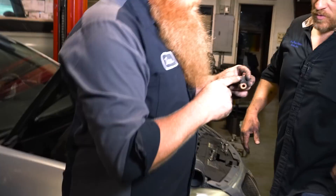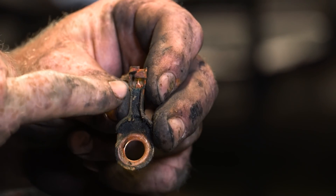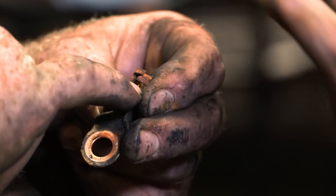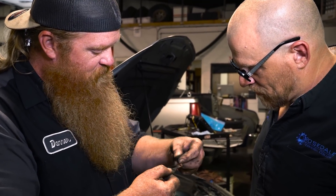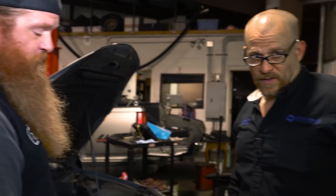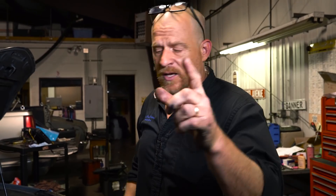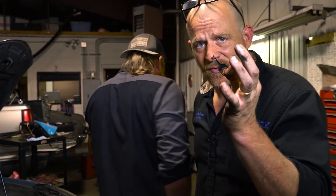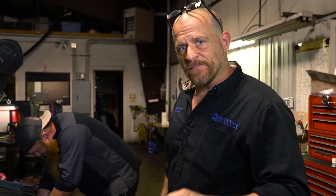You can see how they just fold over these two pieces of metal to hold the insulated part of the wire, then smash them and solder them — so they break right inside there and you can't see it. If you're checking grounds, you're going to have a ground touching the terminal, but the wire itself does not. They break right at the solder joint due to vibration. This is the fourth one in the last two months of this style failing. Look for these connectors on GMs — bad grounds. Wiggle them, do a voltage drop test.